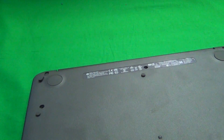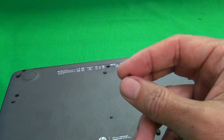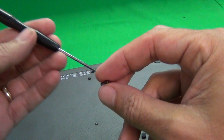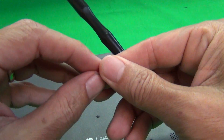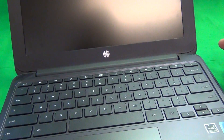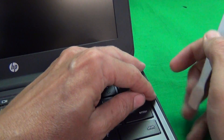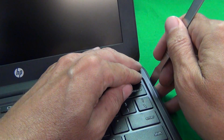To save time, I've already removed the screws with a PH1 screwdriver. This is what the screws look like, and there are nine screws in total. Once we do that, we flip the Chromebook over again. Normally the Chromebook will start up again since we opened it, so turn it off with the power button. Next we're going to lift up the keyboard assembly by prying it open with the spudger tool.